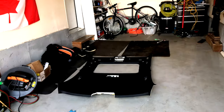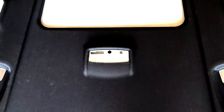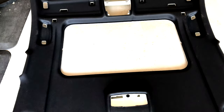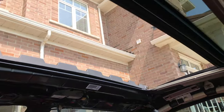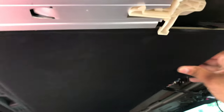I got it out carefully with no damage. About the light right here — you have to take it off after you drop the headliner a little bit. You'll see two metal clips and another wire plug down there — just unplug it and unclip it, then it'll come down. For the sunroof panel, open the sunroof all the way, push it down, pull the plastic clips down, and slide it back so it slides out.